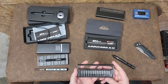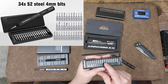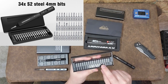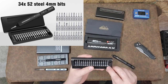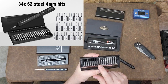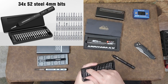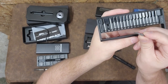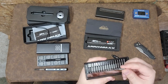Let's go through the bits: I've got a couple of triangle bits, a couple of square bits, a 2.5, a really small one - like a 0.8 or 0.9 Allen. I've got some flat blades, a PH1, PH0, PH double-zero, PH triple-zero - so a good selection of Phillips. I've got some security Torx, some regular Torx - really small ones. I've got some security three-way screws, triangle screws, some pentalobe, a security flat blade. There's one I've never seen before - it's like a cross point, almost like a Phillips without a point at all. Then there's a pin punch - a regular punch.